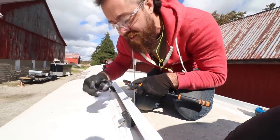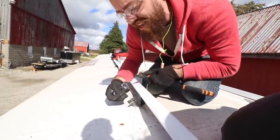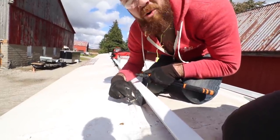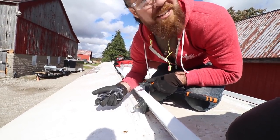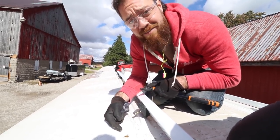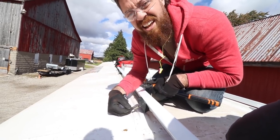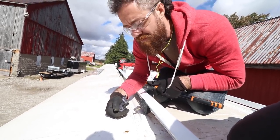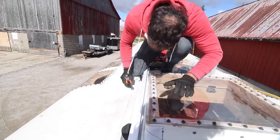So we're leaving that around there because we're gonna put more on the backside of the hockey puck, and then we're also gonna put some thread lock on, the red thread lock, which is the heavy duty anti-vibration, because we don't have a nylock nut on the backside of this and we don't want vibrations to cause the bolts to loosen while we're driving down the road. Make sense? Sounds like a good idea. All right.